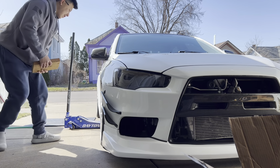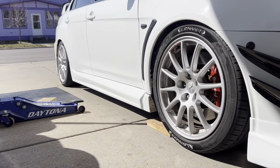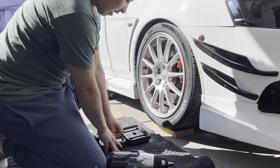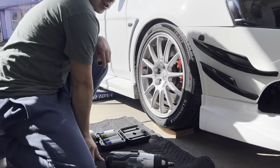Low car problem. Before we jack it up, make sure to kick off the lug nuts while they're still on the ground, otherwise you're gonna be having a hard time doing it.